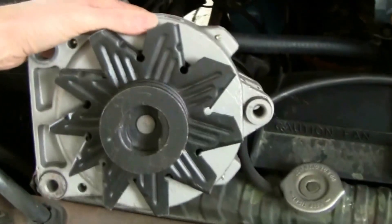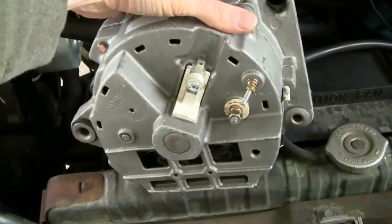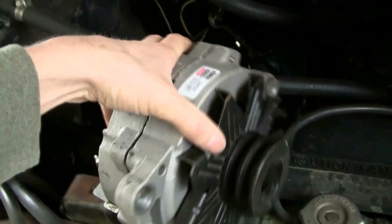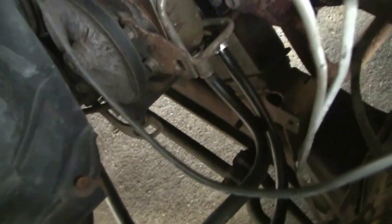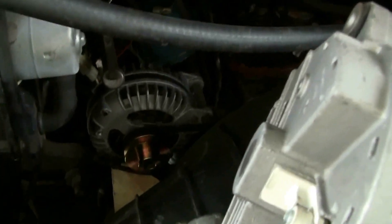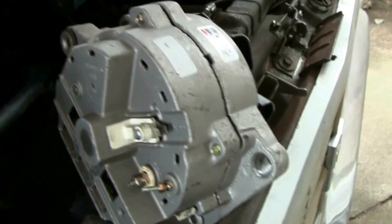Feel free to subscribe or just check back later. Thanks for watching. By the way, if you get online and see there's a higher-output alternator for sale and think you could really use that for your camper because of the high voltage requirements — I would recommend that you don't buy it and then try to install it down there, because it simply doesn't fit. It might be possible to install it where the air pump used to be that pumped air through the manifold for emissions, but it doesn't really work unless you're a metal fabricator. This one does not fit this Dodge 360 engine, much to my disappointment.